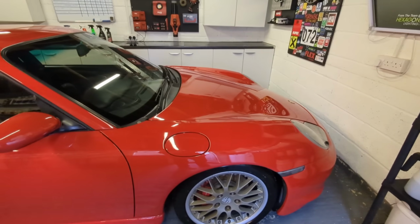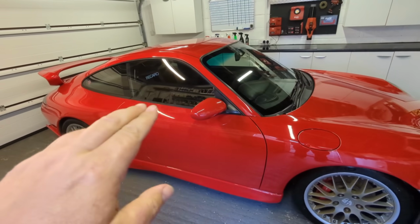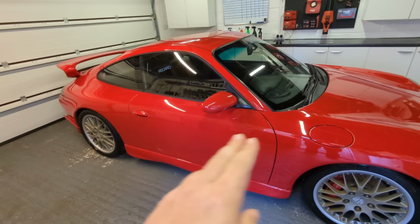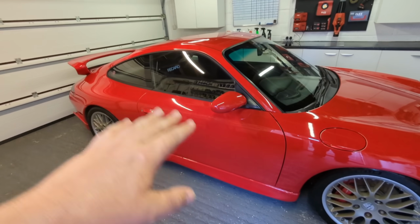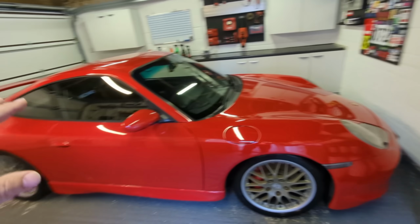So there we go, guys. Now I've applied this, I would go ahead and go panel by panel. I'd do that whole door, maybe half the door, apply it, buff it, apply it, buff it, work my way around, a bit like if you're machine polishing. At the end, you'd go round and apply paste wax, and you'd finish that day thinking, well, it'd take you a few hours, wouldn't it? But you finish that thinking, yeah, the car's looking good. Really good, satisfying feeling.